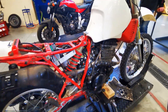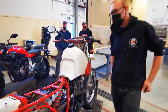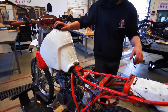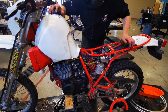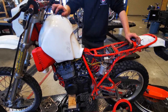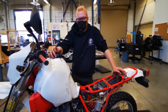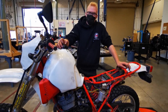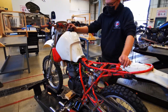We tapped into the crank position sensor on the flywheel. There are two metal tabs on the flywheel — I had to grind one of them off to make it work, because it was giving a double pulse. We had to take one off so it would give a single pulse. And then we also had to spend some time setting up the trigger offset so the timing would know where zero was correctly.